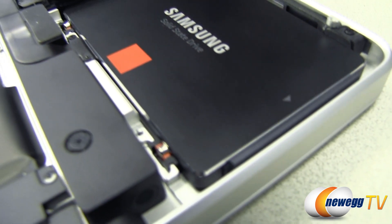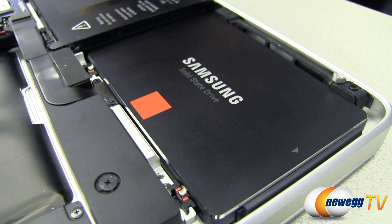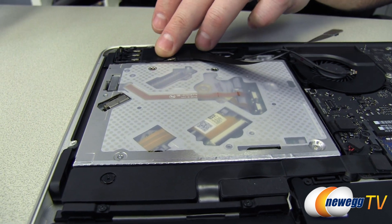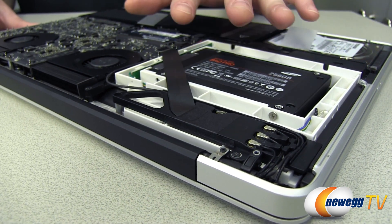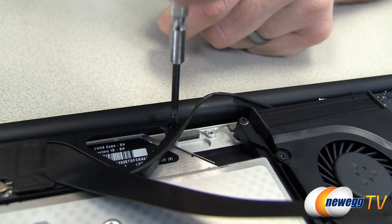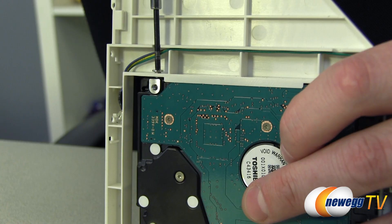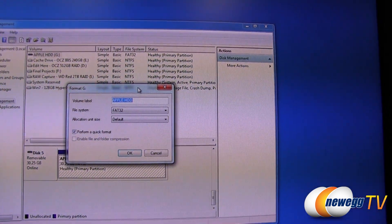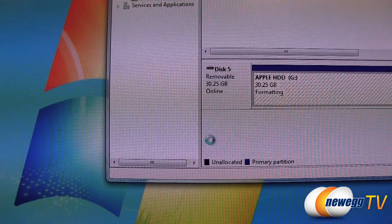Now our software is all configured, but we have one last optional step on the hardware side. If you're only interested in the SSD upgrade and want to keep your optical drive, go ahead and leave it in — just make sure everything is mounted and secured permanently. However, you also have the option to remove that optical drive one more time and go for an SSD plus hard drive option, giving you much greater storage space at the cost of losing the optical drive. Simply remove the optical drive, install the hard drive in the Silverstone Caddy, install the caddy into your MacBook Pro, and format that hard drive to NTFS so you can access the drive from either Windows 7 or Mac OS.